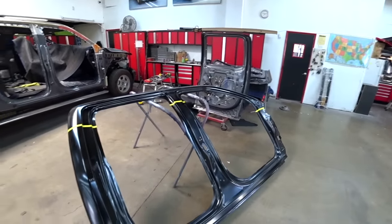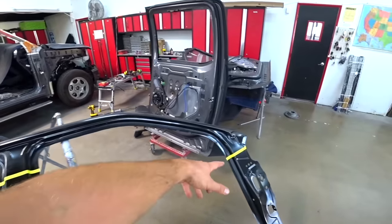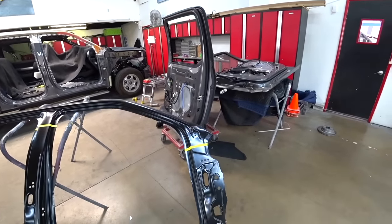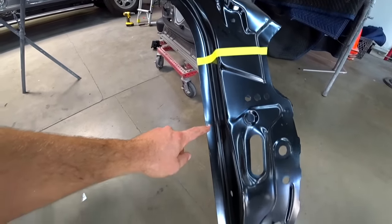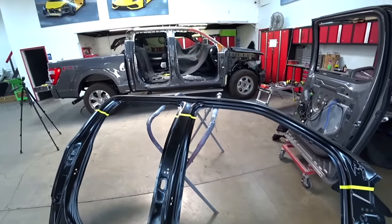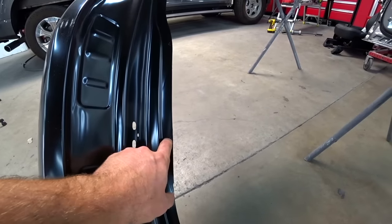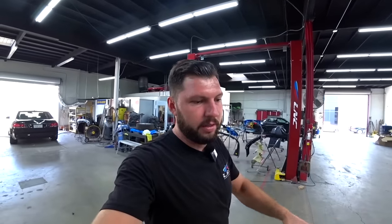And this is our new panel. So we're gonna do a clean cut here, a clean cut up there, and up here we're gonna replace whatever is damaged. Anything else is unnecessary. And the way this panel is designed, there are marks, so you could section anywhere you want. You don't have to replace the whole piece. Let's say the bottom section is damaged. There's a little arrow where you could cut it and then just do a clean section. So that's the plan. Let's cut the top part out, start test fitting, and start welding everything.